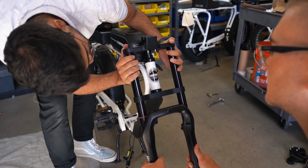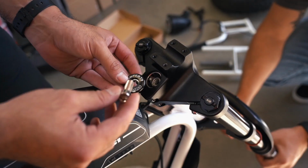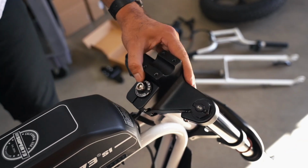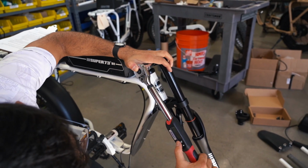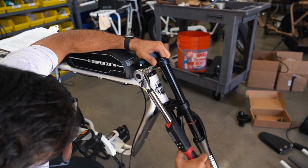Install the top crown from the suspension fork onto the fork assembly. Some force may be required, which may include the use of a rubber mallet. Insert the steer tube bolt into the steer tube cap and then tighten to the point that the fork does not easily fall in either direction. Next, tighten the stanchion screws to a torque of 13 foot-pounds using a 5mm attachment on the torque wrench, making sure the preload caps have cleared the top of the crown.